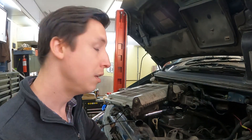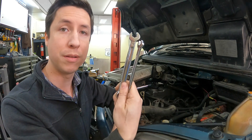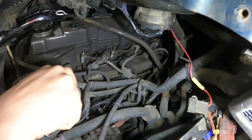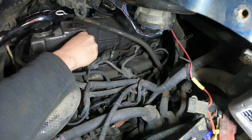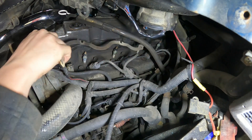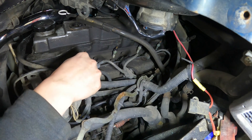With power at the bus confirmed, we can go pull the glow plugs out. Depending on whether you've got OEM plugs in there or not, the sizes may differ. For these OEM plugs, we're going to need a 12 mil and a 10 mil wrench. First we want to loosen off the four nuts on top which are holding the bus bar in place — they don't need to be removed fully, just backed off a little bit. Once they're sufficiently loosened, we can pull the bus bar out of the way. Then with the 12 mil, we can remove the glow plugs.